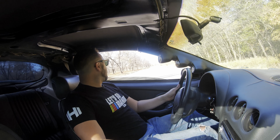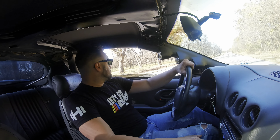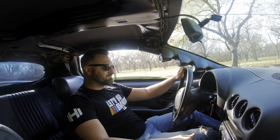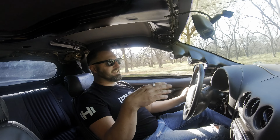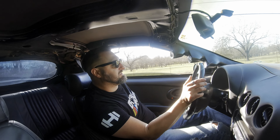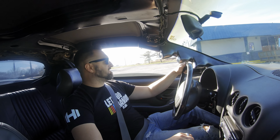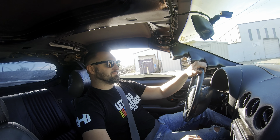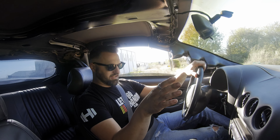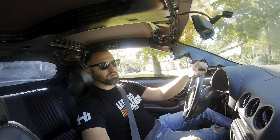Oh please, buddy, make it. She's not happy at all. I got the ICM just barely touching ground, so I think that's probably why it's all pissed off right now. Plus it's probably flooded from me trying to crank the damn thing. Let me get this thing home and swap this ICM out. The one I swapped out is an old GM one I just had in my parts bin - no telling how old it is. I'm going to take another one off - I've got like three or four of them. If none of them work then I'll just go buy a new one.